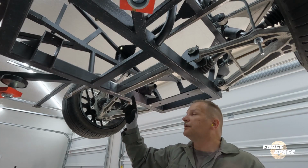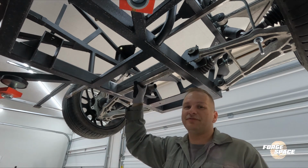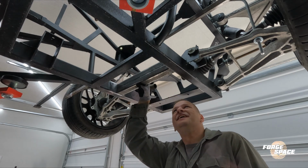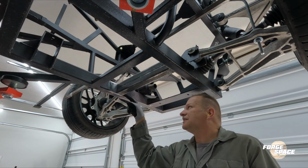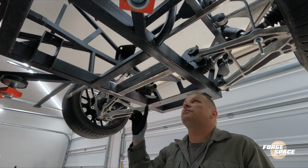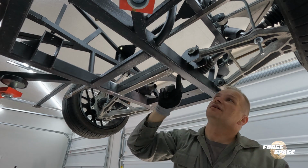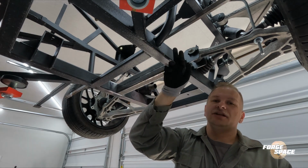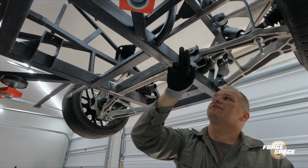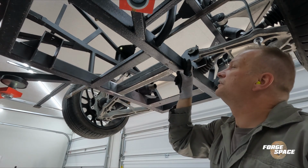All right, it's all lined up, squared up, and in position. It's not moving anywhere because we had to beat it in place, so it was that precise. We'll put some good tack welds on there, and then we'll be able to do some drop links temporarily. Or actually, we can just relocate that drop link before we cut the frame, and then relocate it to like right over here, and we should be good.